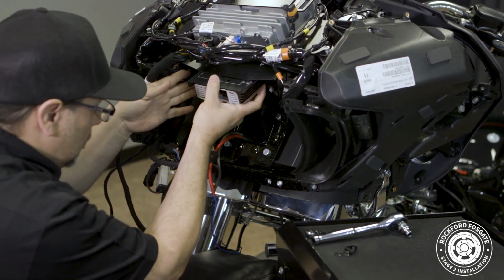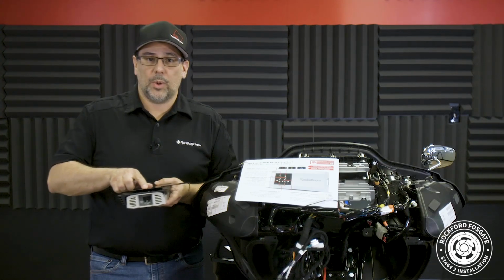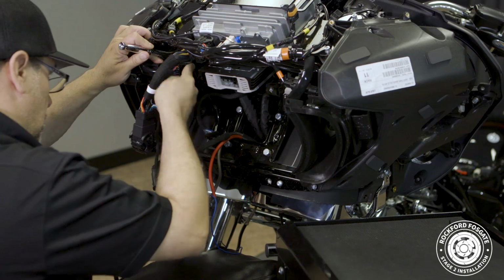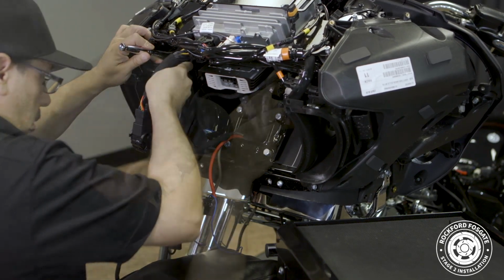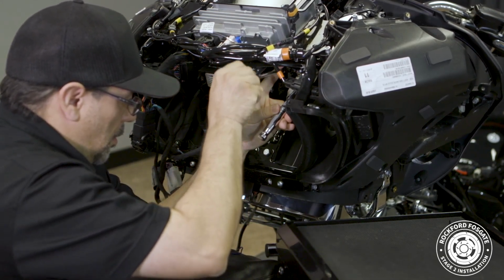Then, flip the amplifier assembly over. Now this lip slides in between the radio and the radio bracket when it goes up underneath. Then we'll use a 5/16 wrench and socket to secure the flaps to the underside of the factory radio bracket using the supplied nuts and bolts.